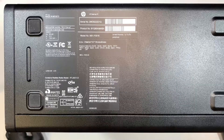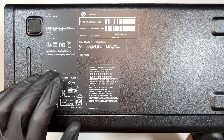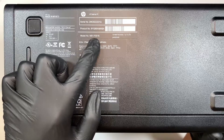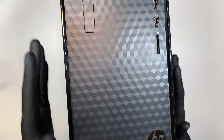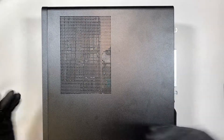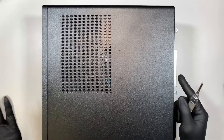Hi, welcome. Simon here and I hope you're doing well. In this video, I'll be showing you step by step how to replace the power supply on the HP Desktop M01-F0016. I suspect there was a power outage and after the power outage, the computer does not turn on anymore. The first thing I like to do is to change out the power supply. Most of the time when there was a power outage, the power supply is the first thing that might get shorted or blown out.